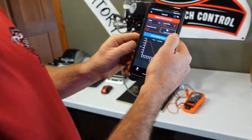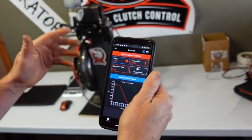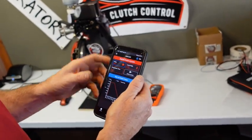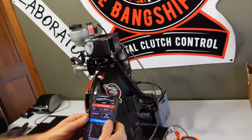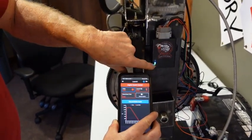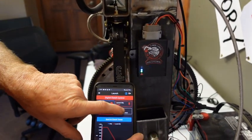On a carbureted car, or a car with an OEM ECU, or maybe even just an aftermarket ECU, you may want to use the master switch feature. On the app, you have the master switch. If it's off, you won't be utilizing the green wire, and the system will work every time you push the clutch switch — maybe not ideal. One quick way to make sure the app is in fact communicating with the controller: whenever you make a change, the green power wire will flash, indicating that it's accepted the change. The quickest way to do that is just hit the master switch button.